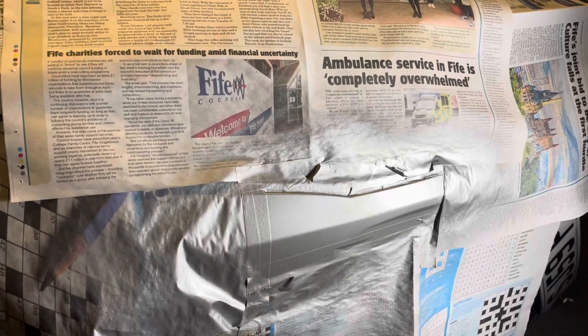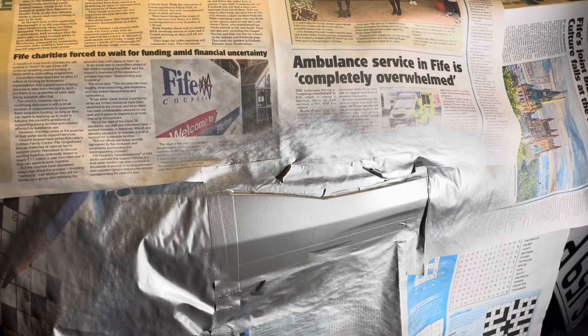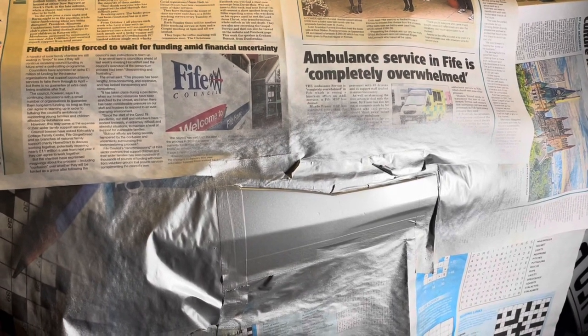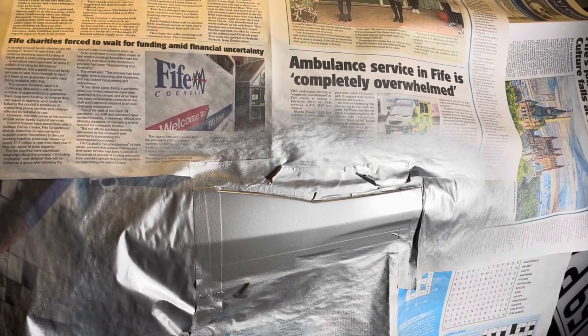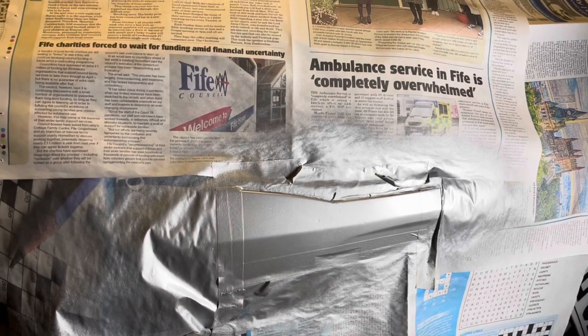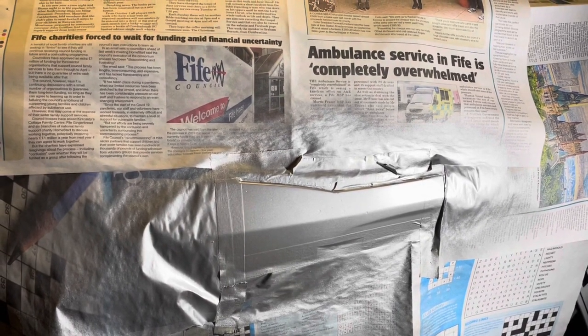So that's all the painting done. I ended up putting about 3 coats on it, and you can see that mark's completely gone. I'm going to drive the car a little bit further into the garage and just leave it overnight before applying any clear coat. I'm going to give it a little buff down with 1200 grit again prior to putting the clear coat on, and then hopefully when we strip it all back and put the number plate back on, we'll see how it's all going to look.